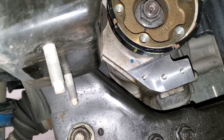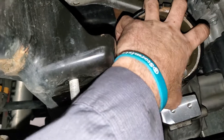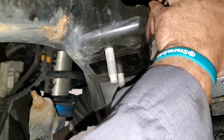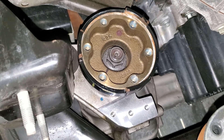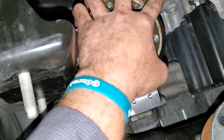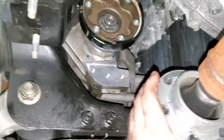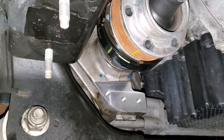I marked the top of the flat on the actual pinion itself, and basically I went back and felt for it — it's the same as it was before. No up-and-down movement, no in-and-out movement, so I'm good. I went tight and then just a little bit more. The thing that was wrong was the seal was leaking, but now the seal is not leaking anymore. I'll put the drive shaft back up and zip all the bolts down, then go test drive it.